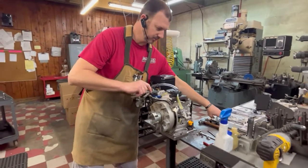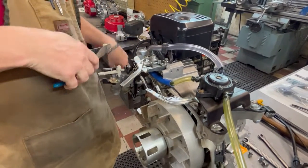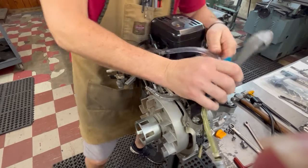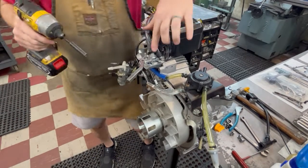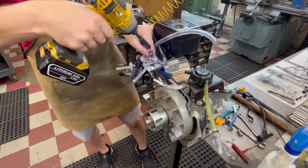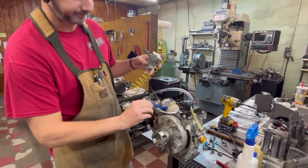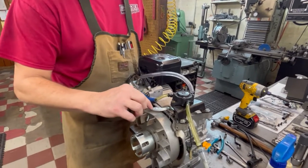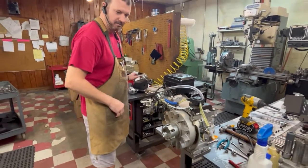It's just these two nuts. Now we may as well go ahead and remove this plate because we're no longer going to use it. I'm going to get my pulse line off of here. I've got two bolts holding this little throttle plate on - remove both of these. Now we take this off, we're going to have the spring up under the bottom. You can see all the extra holes I've drilled in this governor arm in the past trying to get this engine not to close the throttle shaft so soon, but I never succeeded.